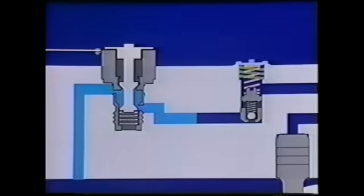When the brake is activated, the electric coil pulls the disc of the solenoid down against the pin and ball check, permitting oil to bypass the mechanical stop and fill the passage to the control valve. This exerts sufficient force to raise the valve and index with the high-pressure passage and unseat the ball check. Engine oil then fills the passage between the slave and master pistons and moves the master piston down against the injector pushrod or, in some engines, the exhaust pushrod of an alternate cylinder. The pushrod is moved up against the master piston by camshaft rotation, creating sufficient pressure to move the ball check down, creating a closed hydraulic system between the slave and master piston. The pressure of the entrapped oil increases, providing sufficient force to move the slave piston down and open the exhaust valve just before the piston reaches top dead center.